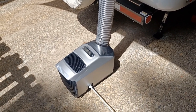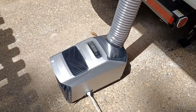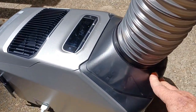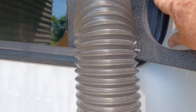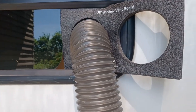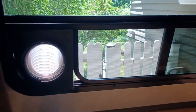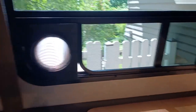Here's how to use the EcoFlow Wave 2 externally. In that case, you hook the small hose up to the front and put it in through a window hole — you don't use the larger tube. This is what it looks like from the inside: we have cold air coming in just through here. One disadvantage of this is you need some output since it's pushing cold air in. I recommend opening the top vent here a little bit just to allow the warm air up high to escape.